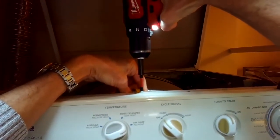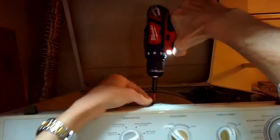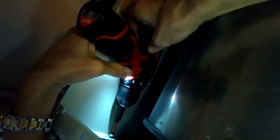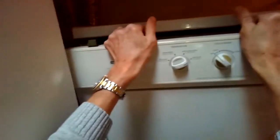I'm going to check a little bit deeper into the mechanism. I'm going to remove the little plastic piece that holds the drum in position and take out a screw in the upper left-hand corner and also in the upper right-hand corner. These are inside the dryer, so you have to keep the top propped up and remove these two screws. Then the front panel comes off pretty easily. I grab the front panel and pull it toward me.